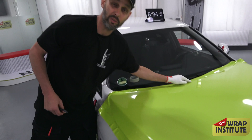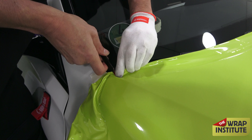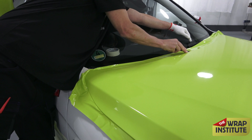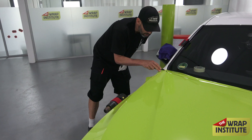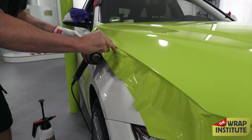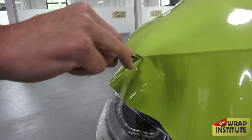Because I've relaxed the material, when I go to cut, it won't shrink — which is great. So if you're a good wrapper, it's all about relaxing. Now I'm ready to cut with my sharp blade. I always cut the corners first because corners are the hardest — you see a lot of people online say 'I got a strong corner game' because they're really proud of their corners. Notice I changed body position so I can work the material down the side. The blade I'm using is a 30-degree blade — this one's red, which is cool. That's what Pro Series is about: good tools that are branded to separate you and make you look professional on location.